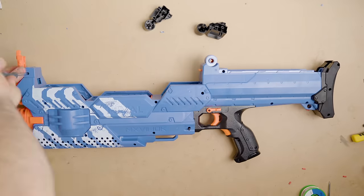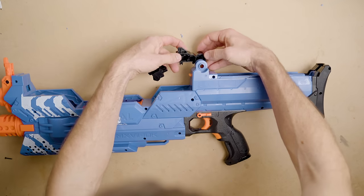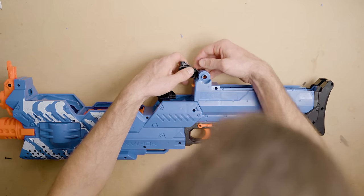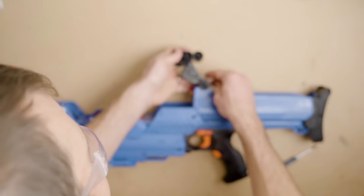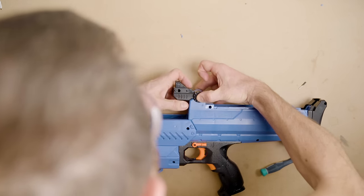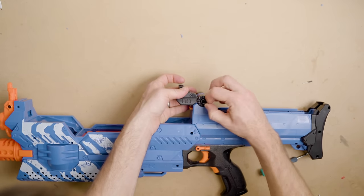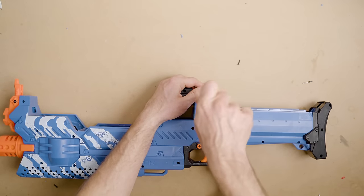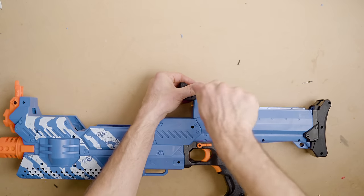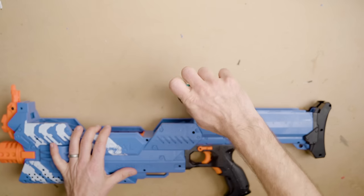Remember to take special care with these two screws and the front screw. After all screws are in, replace these two bits here — this lines up with the part inside that actually allows your jam door to open. It's easier to put one side in first and then try to get the other side in. When you've got it in correctly, it should pull that tab. The front bottom screw is hacked in half, but it is plenty tight and not going anywhere — hopefully it doesn't happen to you. It happens on about a quarter of them.